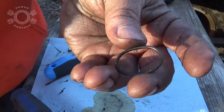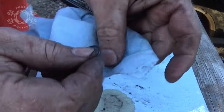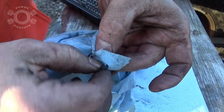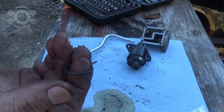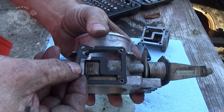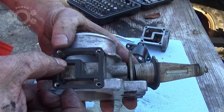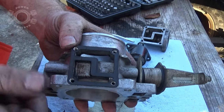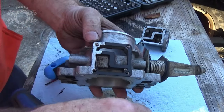Clean up your o-ring — just take your shop towel, put it between the layers, and gently pull. It'll take all that junk off pretty easily. Now it's time to put it back together, but I showed you guys a moment ago that the gasket for the idle air control joining the body broke. I'm about to do something that's going to cause some of you to lose your mind. Proper procedure is to go buy a new gasket, but that gasket isn't exactly easy to find.